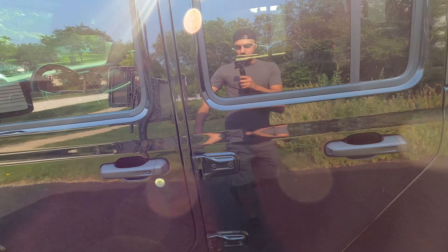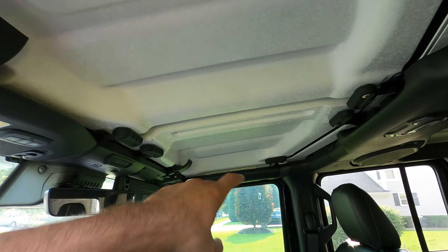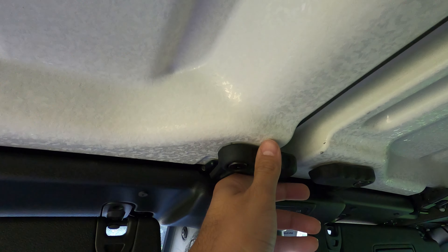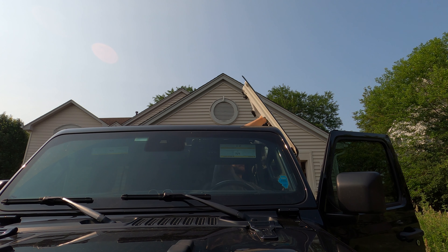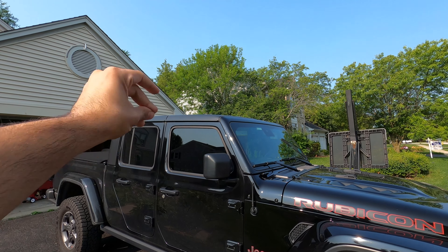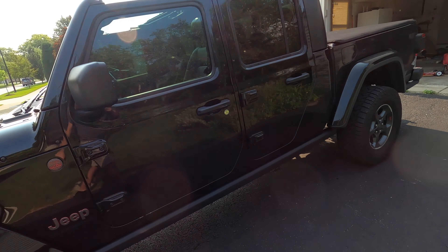So we're gonna go ahead and start taking all the doors off. When fully stripping the Jeep down, the first thing you want to do is take off the two panels - the one that goes above the driver and the passenger. They're super easy. First thing you want to do is put the windshield visor down, pull it down, and there are four levers. The thing is completely loose and you can just push it up. That was the driver side, I'll do the same thing for the passenger side.